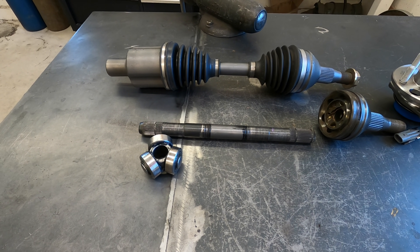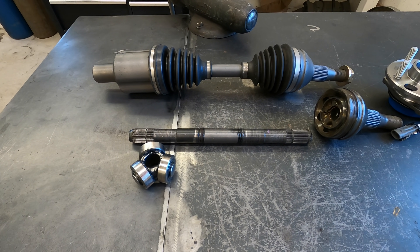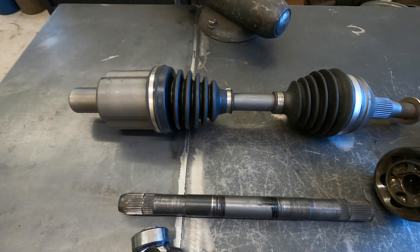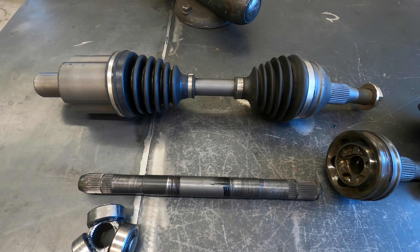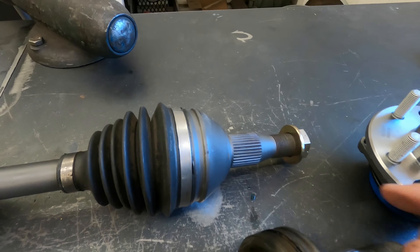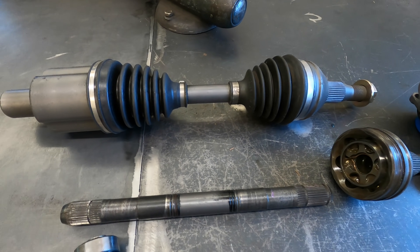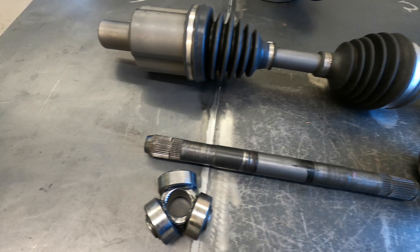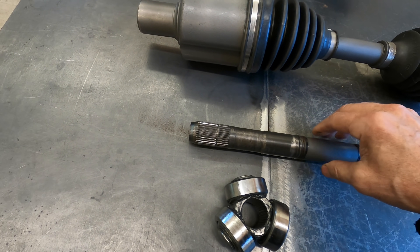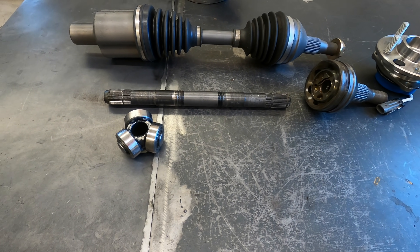I did some work on the chassis, but first I wanted to discuss the axles because a lot of this revolves around how short I can make the axle shafts. I started with mid-90s Cadillac Deville half shafts — rebuilt models — because I had to start with something. They're 33-spline going into the transmission and 33-spline outer, which is one-ton stuff. I was hoping I could just replace the axle shaft itself with a shorter one, but when I took it apart I found the axle shaft is only an inch in diameter and 35-spline. I don't trust 700-something horsepower on one-inch axles.